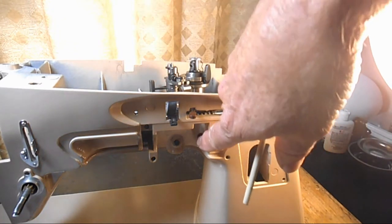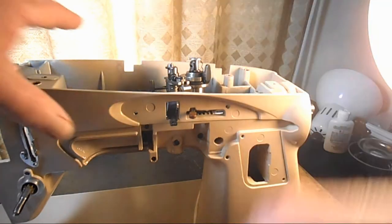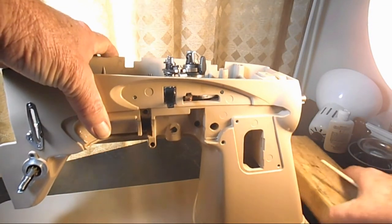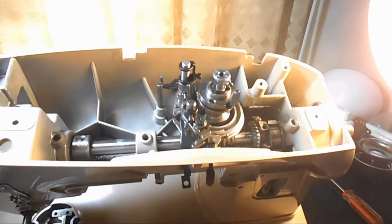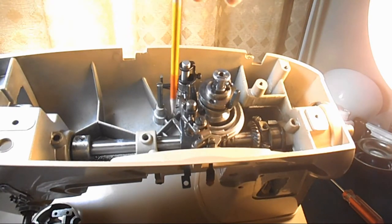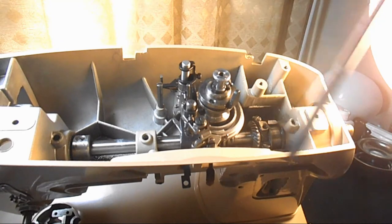So, you know, loosening one set screw and pulling out the shaft is pretty easy, but in this case you first have to remove many associated parts, which also isn't that bad, but the problem lies in putting them all back in, and then there's many adjustments to be made to get them to function properly. And that's what's time-consuming and intricate. And why I usually don't remove these parts. If I can get them clean and if they function okay, or I can just adjust them in place to function okay, then I don't see the necessity of taking all this assembly out.